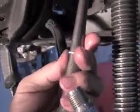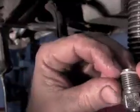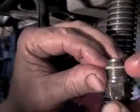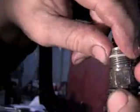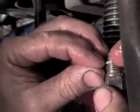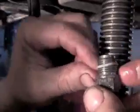You slide it off, and you try it again to see how close your sizing is. In this case, we've got it not quite, but we can go ahead and work it without forcing it. And that's what you want, because if you get it loose enough that it falls on there, once it gets to the bottom, it'll fall on out of your groove down here, and you don't want that either. But you'll just want to work it a little bit at a time.